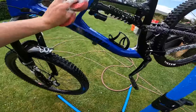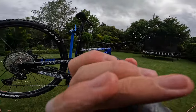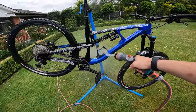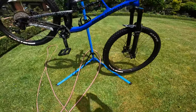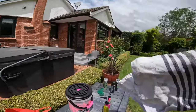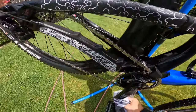After you're sure you've got most of the dirt off, rinse it off with reasonably high pressure, standing a couple of meters away. Use your hands if needed to make sure all the Muck Off solution is off. Then grab a tea towel or rag and pat the bike down — you'll be surprised how much dirt you can still get off just by wiping it. After that, we move on to the second stage: degreasing.